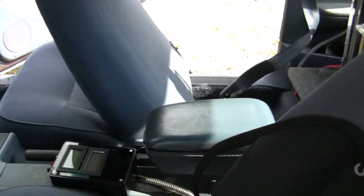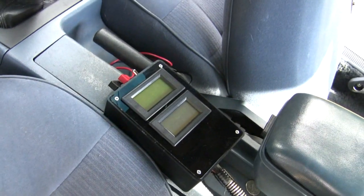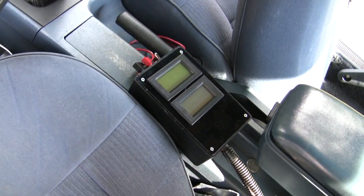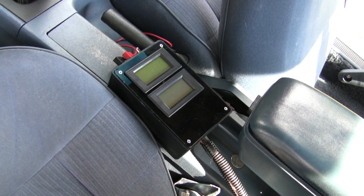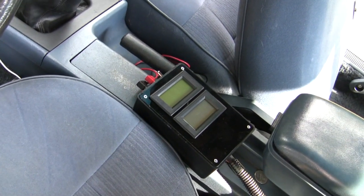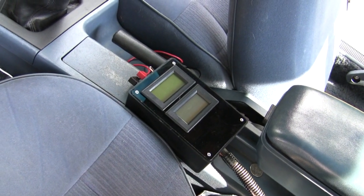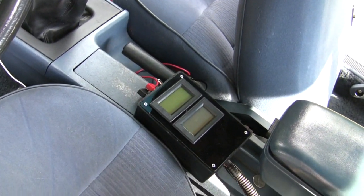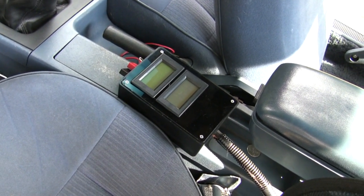In the front seat here I have my controller. The top gauge is the voltage at the cell on the plates, and the bottom gauge is the amperage going to the cell on the front of the control panel. You can see the banana plugs — those provide the EFE voltages, the O2 sensor voltage going in and the voltage coming out. Also my MAP sensor voltages I can plug into. It also has a large switch there for master shut off, override — whatever you want to call it — so I can turn it on and off.